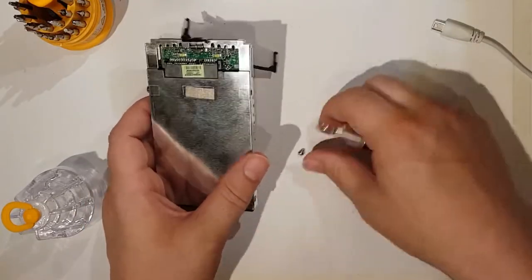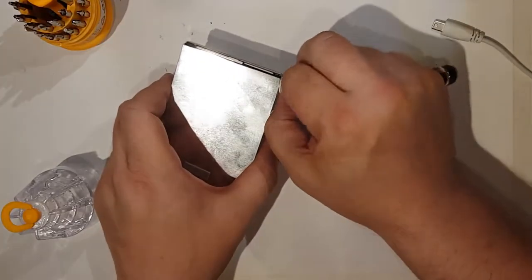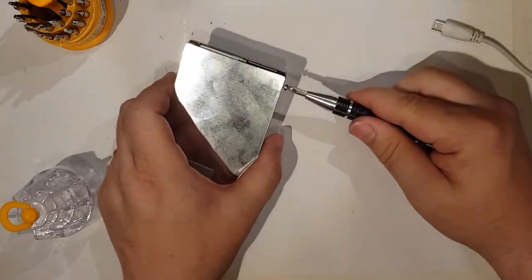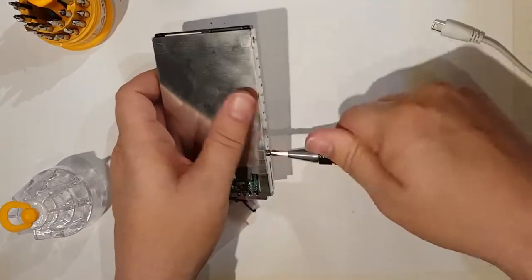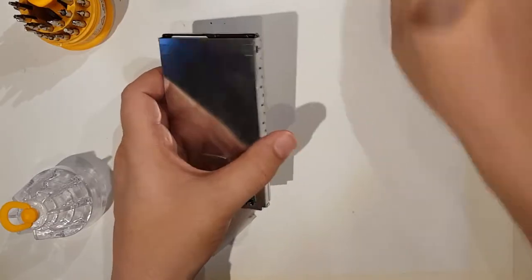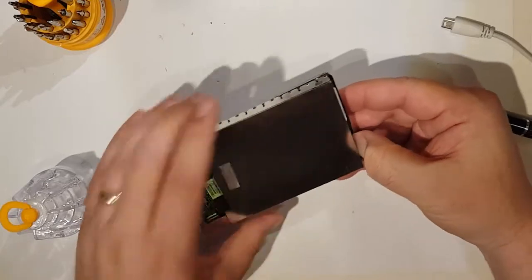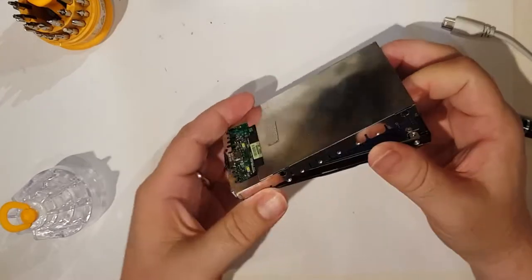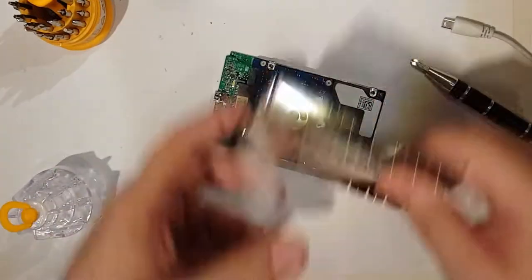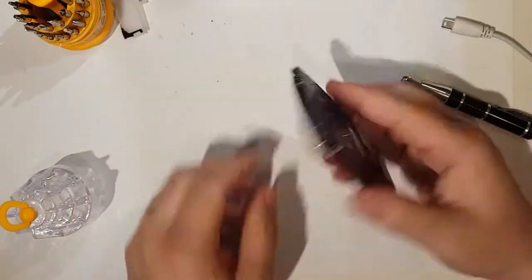I wish I could remember who it was, but he said that people think that you can't take these drives apart without killing them, but of course if it's dead anyway, it doesn't really matter. But the head being stuck to the platters, if that happens, can stop it spinning up, and that can be the problem. And that might get this disc to be able to boot again, which will then mean I can get some of the data off for my friend.